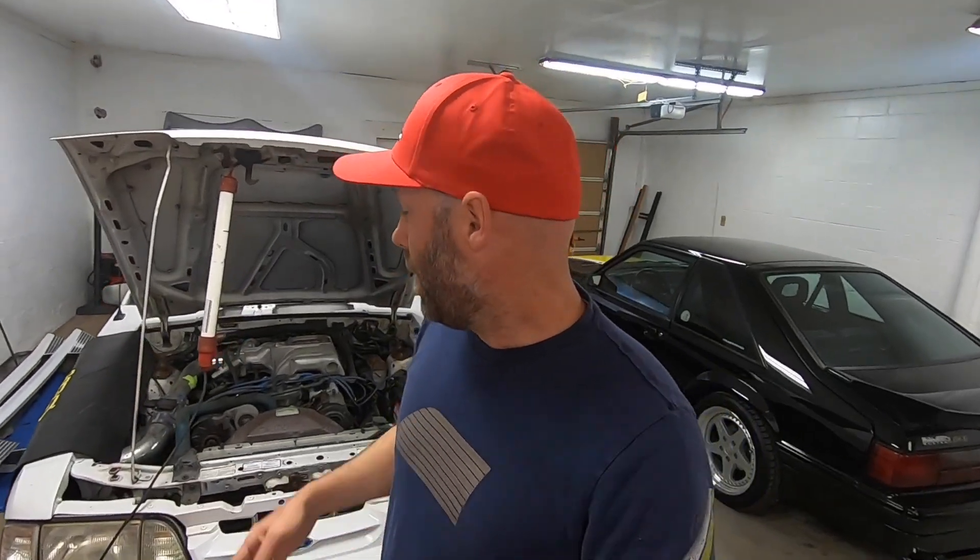There are three capacitors inside, and it's pretty much the same on mass airflow computers. The speed density may be a little different - I haven't torn into those - but on the mass airflow ones: the A9L, A9P, X3Z, etc., they have three capacitors in those locations. There are repair kits on eBay, and local electronics stores likely have the capacitors in stock. That's something to look at when you have a car of this age that's been sitting or giving you a headache.